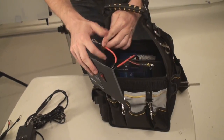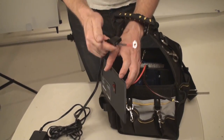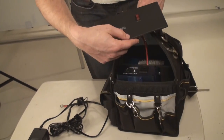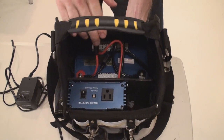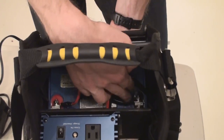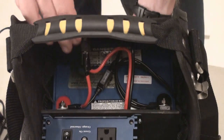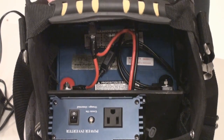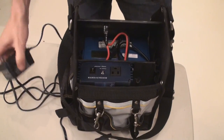Let's pack it and see how it will work. It fits tight, but that's exactly what we need. Now we need to connect the terminals. Plus, we connect the two wires from the charger. Now we've got everything connected — both wires from the charger and from the inverter go connected to the battery, and the big wire from the inverter connects to the switch.